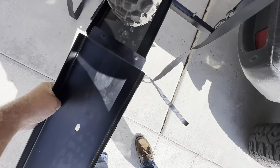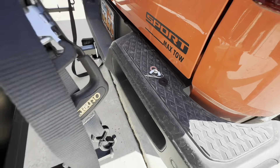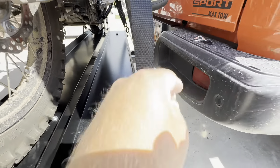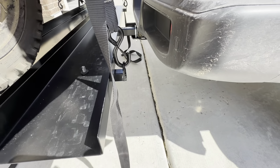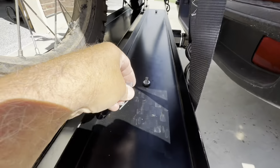You can disconnect the ramp once you've loaded and slide it right in for storage. I've already taken off the wing nut and washers. The bolts are part of the cross bar that holds the ramp in place — put the plastic washer on, then the flat washer, the wing nut, and then the keeper pin to secure it all in place.